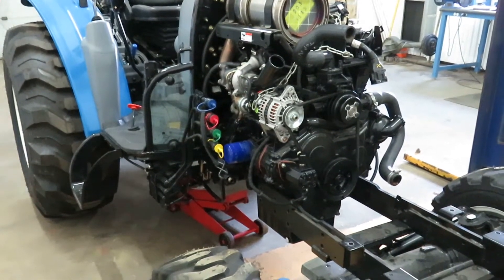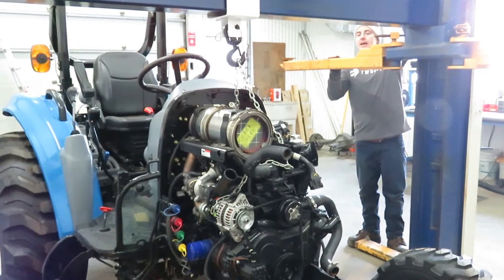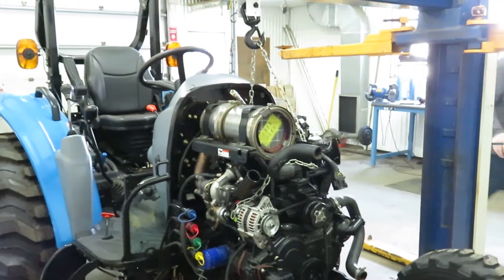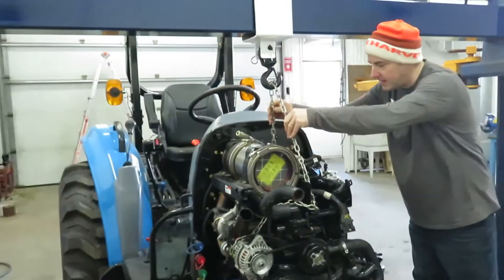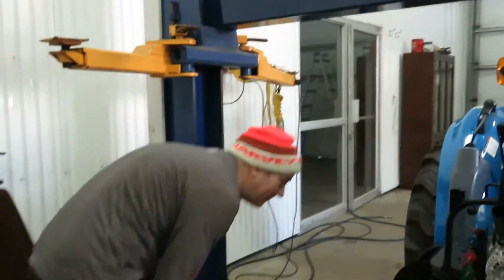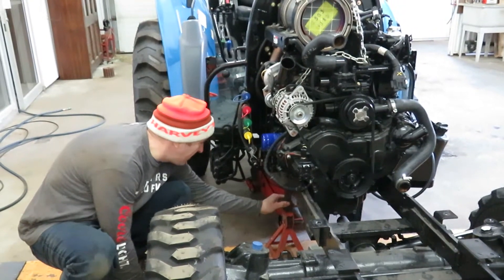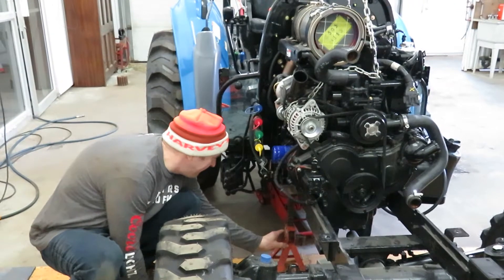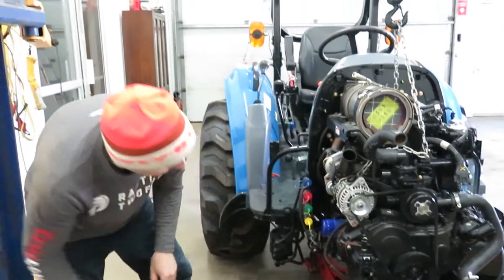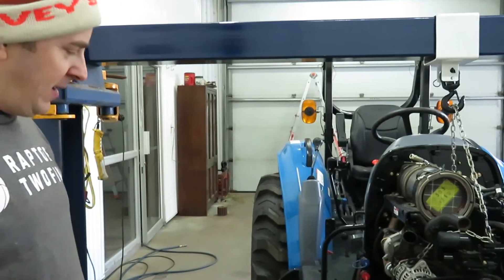I'll stop there to have a look at what's going on. I'll raise the beam up to take up some of the slack. The reason I'm doing this is I have to get underneath, so I have this taking up some of the weight, plus the trolley jack on the floor taking up some of the weight. I'll also install a safety jack right underneath the engine block here for safety - if the trolley jack and the two-post lift fail, everything will be suspended on that security jack.